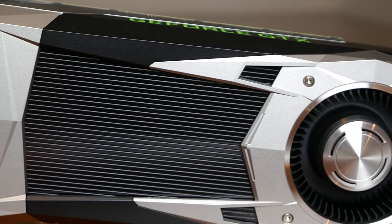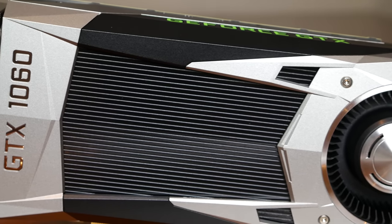I'm not really going to get into a lot of specifics about the cooler design. It's obviously very similar to the rest of the Pascal lineup as far as the redesigned reference cooler from NVIDIA. The GTX 1060, instead of having a clear window here, has some black plastic. The shroud has been kind of redesigned to look like — I don't know — the Millennium Falcon or something. It's got some new angles along the side and cutouts for airflow. It intakes air through the front of the card, and the blower-style fan pushes it out the rear of the card and out the rear of your case. It is the first time we've seen a reference design cooler on a 60 Series graphics card from NVIDIA.